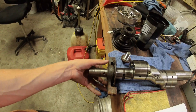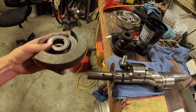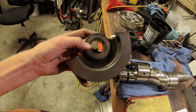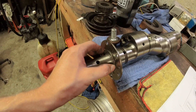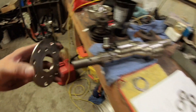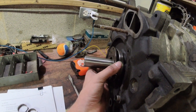The front pulley comes off, then the timing gear — make sure the chamfer side goes towards the engine, otherwise your timing will be off. The oil pump drive gear comes off, then the counterweight. Inside the counterweight there's a washer — it usually stays in there. If you're doing a quick rebuild you don't necessarily have to take it out, but make sure to get some oil in there so it's not locked up.